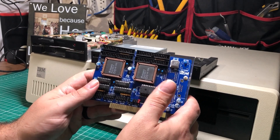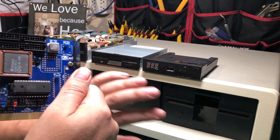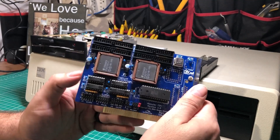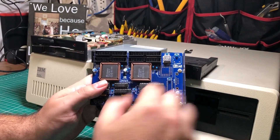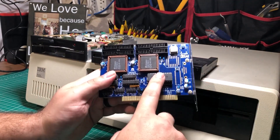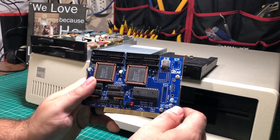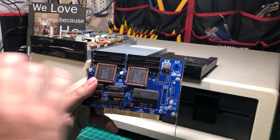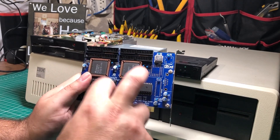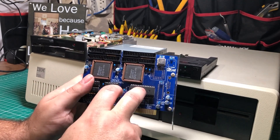That's the magic that makes it work, because the BIOS in this machine and a lot of the old machines didn't support — they didn't even know that 1.2 and 1.4 meg drives existed. So what this thing does is handle all of it. You tell your computer you don't have a floppy controller, you don't have any floppy drives installed, and let this thing work its magic. Now I will say that I did run into one problem — or maybe a hundred — building this thing, but I've worked all that stuff out for you, and I'm going to show you exactly what to do. You're going to want a very specific version of this BIOS and to follow some instructions. So let's get started.